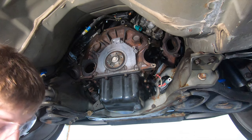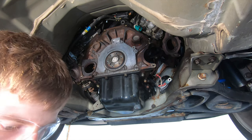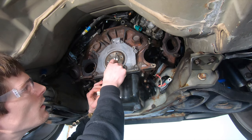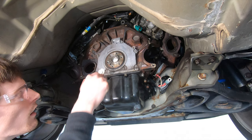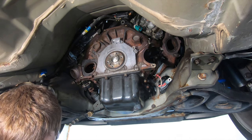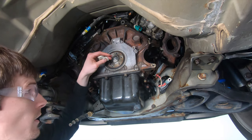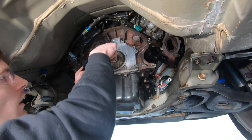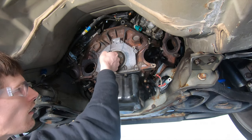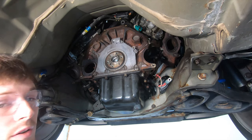There you go — it just takes time. Now that the bearing is out, come in with a screwdriver and pop all that bread out of the crankshaft. It should just pop right out — it comes out in pieces, not one giant gob of grease. Hit the inside with some brake cleaner and wipe out the bread residue. That's probably the easiest way I've found to remove a pilot bearing.